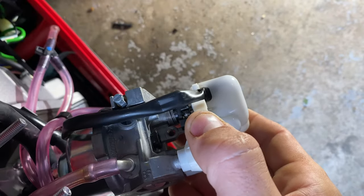Just to sum everything up — I put some fresh gas in it and it's running good now. Fresh gas and the carburetor cleaner did fix my issue. Before I end the video, I also wanted to show what I dip carburetors in if they're really dirty and the carburetor cleaner won't get it out — this chem dip here. I also have a small wire brush that goes on the end of a drill to clean the carburetor bowl. Any questions let me know. I'm going to have a comparison video between this one and the Companion series uploaded right after this, so check that one out — and subscribe, it helps out a lot.